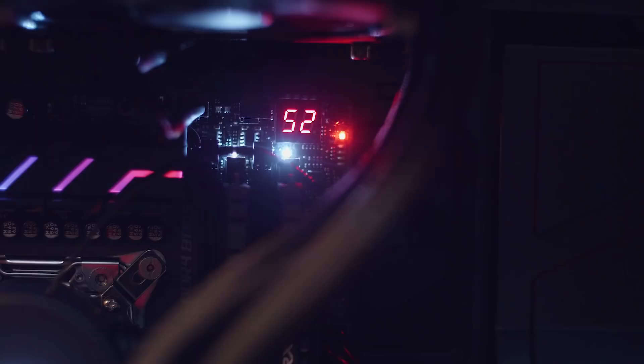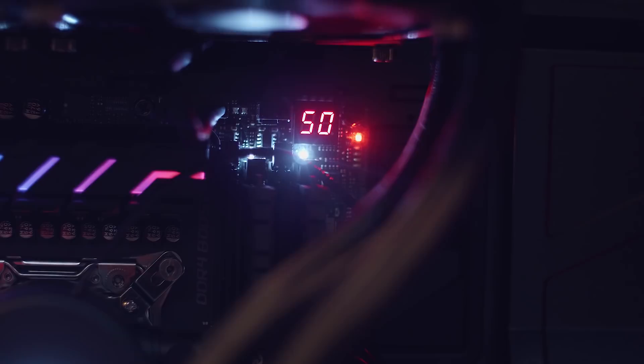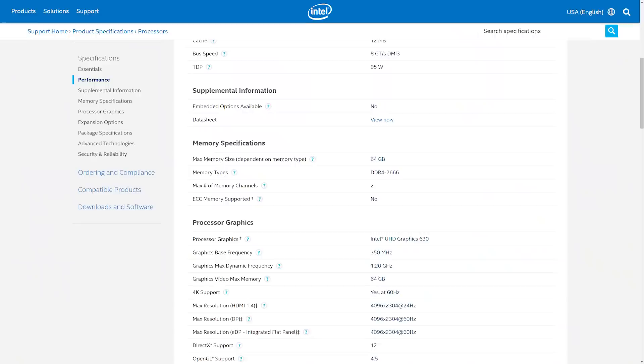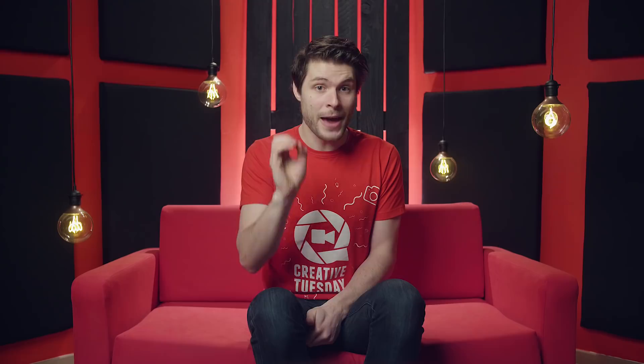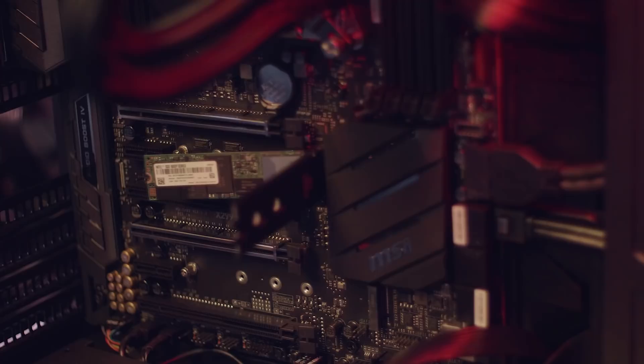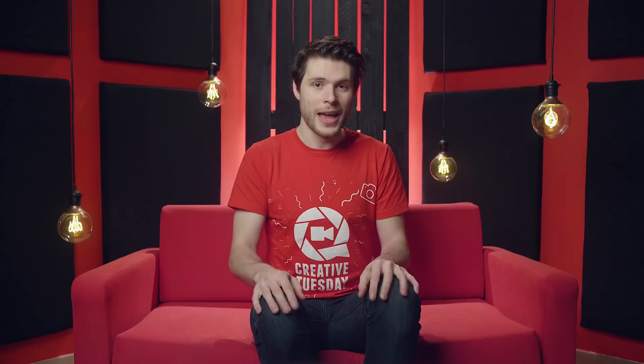The final thing I want to talk about is the motherboard. Although it just seems like a large connector for all your components, compatibility is one thing, but utilizing the capabilities of your components is a different story. If you purchase fast RAM memory but your motherboard doesn't support those speeds, you might only be using half of what your memory is capable of. If you don't have the money for a high-end motherboard, then don't spend extra money on fast memory either. The same goes for your processor — check the maximum RAM speed it can handle in its specifications. Double-check that your motherboard has all the connectors you need and is compatible with all your components. If you bought an M.2 SSD, you'll need a socket for that on the motherboard. I would always suggest working with an IT store — let them check your wishlist and build your PC. If anything doesn't work, you can always go back under warranty. Trust me, it's worth the extra 50 bucks.